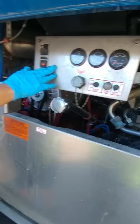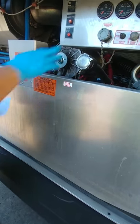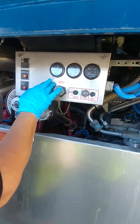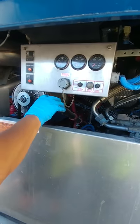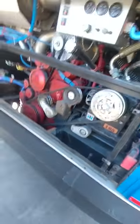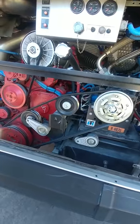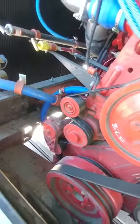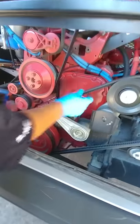While I'm in here, I want to turn off the bus so no one can turn the bus on while my hands are in the engine. On this box we have three gauges — oil, water, and transmission; the bus would need to be on for correct readings. Right here is where you would check the oil. Inside of here, we have three belts — your compressor belt, your alternator belt, and your water belt. Make sure all three are present, free from any damage, not cracked or frayed in any way, and they have no more than three-quarters inch of play in them. Right here you have electrical wiring — indicated by the ribbed covering. Make sure there are no exposed wires and they're all securely mounted.